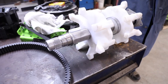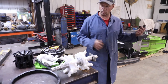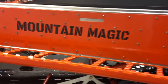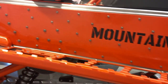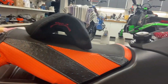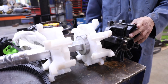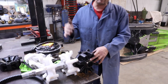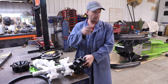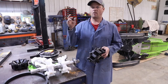None of the manufacturers offer this system for this older sled, so you have to suss it out. My good buddy at Mt. Magic, Ken, ordered me up a set of 7-tooth, 3.5 pitch drivers. They are a little bit bigger in diameter, which is going to help it turn over nice and gears it up a little bit, so I'll get a little more speed out of it. Plus, this thing's going to roll over so nice because I clipped the track and cut all the nubs off. This thing is going to be awesome.